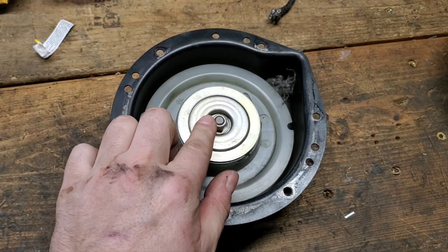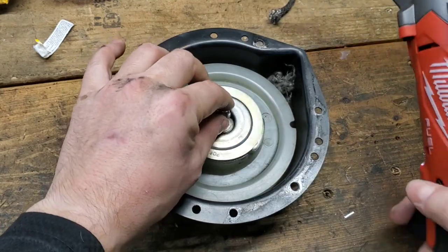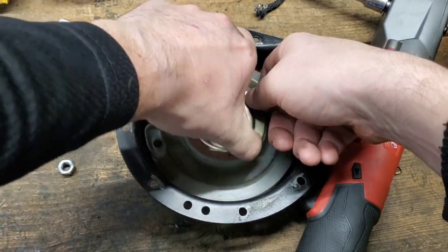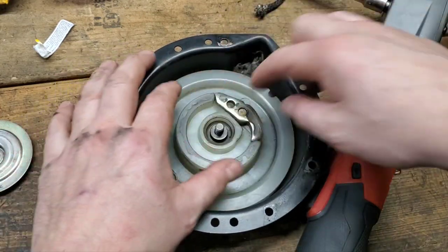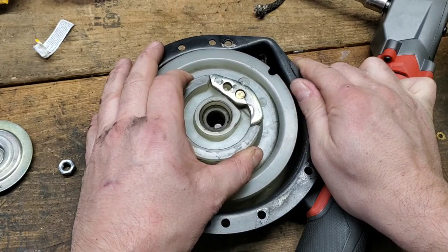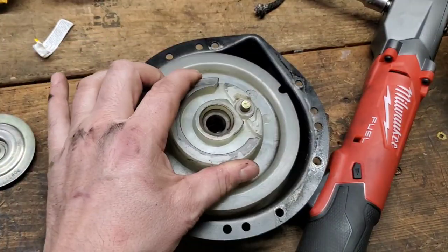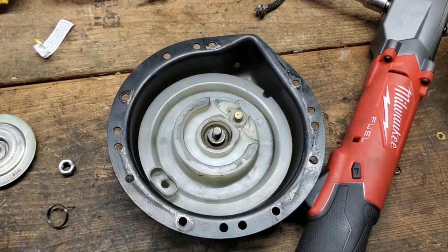Over on the bench, all we have to do is take a half-inch socket to get this center nut off here. You can see this has quite a bit of play in here — there's a lot of wear going on. Now you can buy replacement parts for this, but they get quite expensive. By the time you add up all the replacement parts, you've paid just about as much as you would for the entire recoil. You can see it's getting pretty wallowed out in there. Once that happens, they tend to want to bind up on you — when you pull the cord all the way out it kind of binds and doesn't want to recoil in properly. So I find it best to just replace the whole works.